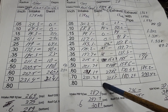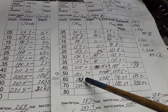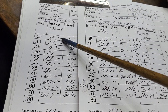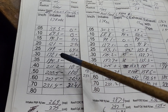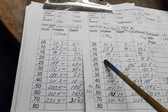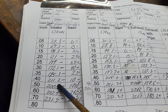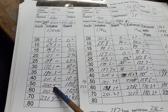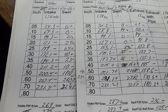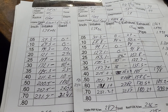So this is what we had — not bad. If we run it at 600 lift, we got 231 and change. Not great, it's less than I figured I could get, to be honest. That little lip on that valve does cost some CFM — it costs CFM through the whole curve. The losses are around 4, 5, 6, 4, 3, 2, 4, 1, 3, and 1 CFM at various lift points. Is it worth it? When you're barely making it as it is, I don't know.